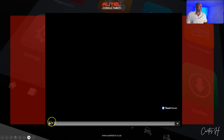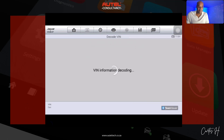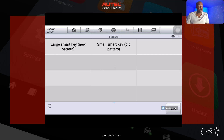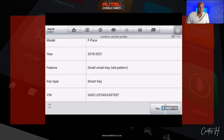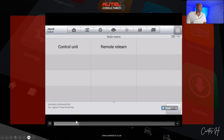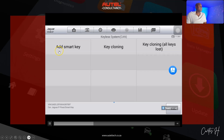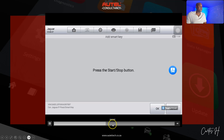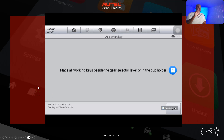When we logged in, he showed me the key cloning function route he had taken, and I told him that approach probably wasn't the best one to start with. I said let me try to see if we can do it through the OBD like we did for the Range Rover. I can see the VIN, I go to Control Unit, then RFA Replacement — or more specifically, Keyless Entry System — and then Add Key. Once we click that, we press the Start/Stop button and click OK.